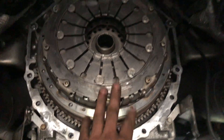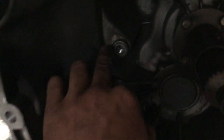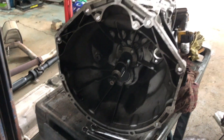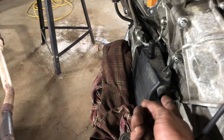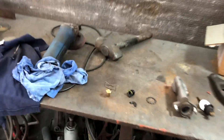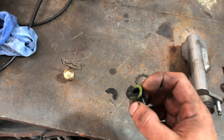I'm going to brake-clean this clutch up really good and go with it. I've got most of the brass filings cleaned out of the transmission. The transmission had to come out to change the slave cylinder. On the road trip, the slave cylinder exploded and blew all the fluid out — the car just wouldn't start after we shut it off. Big tow bill to get it home. The parts should be here soon, and also the filler plug for the SMG reservoir split in half last time, so I'm replacing that too.